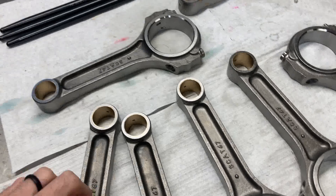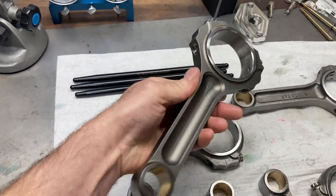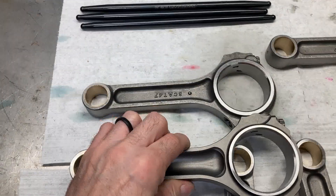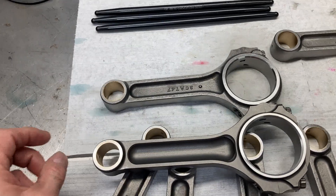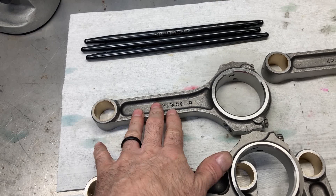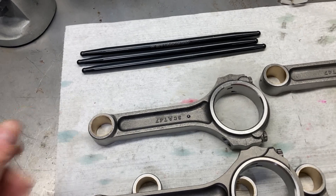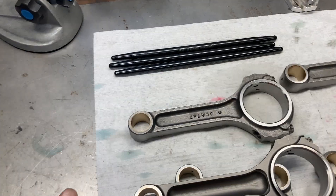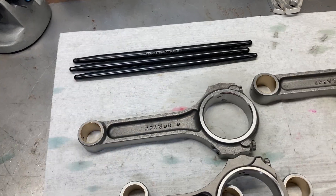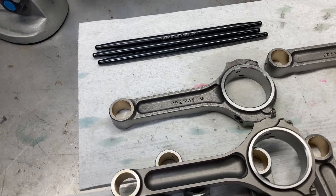I'm going to show you something else. This is an Oliver rod, a Big Block Chevrolet rod. These are $1,500 to $1,600. Look at the rod design — it is an I-Beam rod. So do not look at an I-Beam rod and think that's a weak piece of junk. The design in and of itself can be very very strong. When you're paying $470 for a set of SCAT I-Beam rods, paying an extra $600 or so for H-Beams is just not necessary, and you do yourself a disservice because the rods are heavier which means you may have to add more weight to balance your crank.